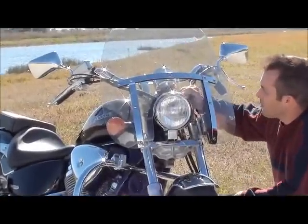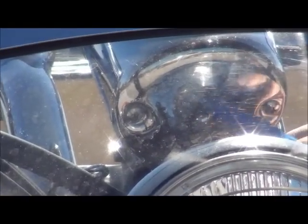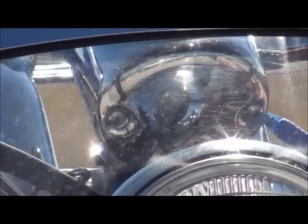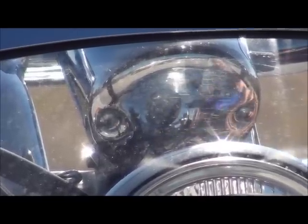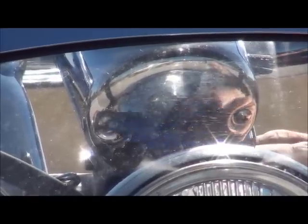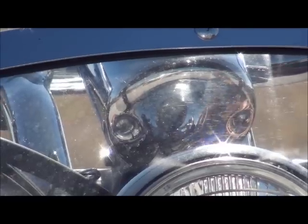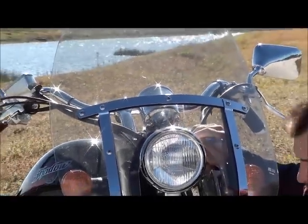On the odometer, there's either retaining screws or retaining bolts. What you're going to look for is any fraying or turning on these screws. Have they been taken off? If they're bolts, check to see if there's any turning around the outside of the bolt. And if there is, walk away from the bike because that odometer has been changed. There's no reason there should be any marks around here at all.